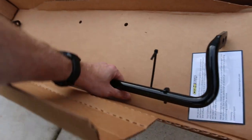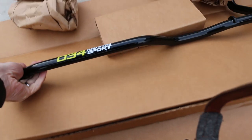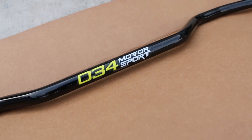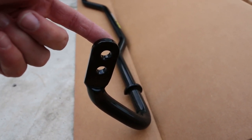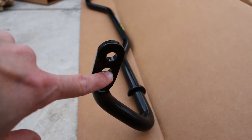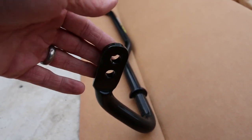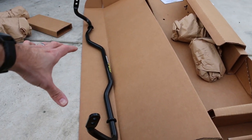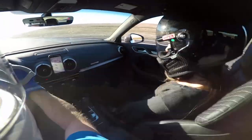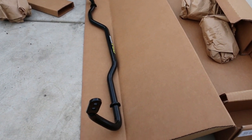As far as suspension components go, this is the best packaging I've ever seen on suspension parts compared to other sway bars I've installed. It has limiters where the bushings sit on the car, the 034 Motorsport logo, and two adjustable positions on the sway bar itself. The furthest hole is the softer position; the closer hole is the harder/stiffer position — 52% stiffer than the original hollow rear sway bar. This solid 22.2mm bar is really going to stiffen up the rear, help the rear end rotate, and provide more oversteer.